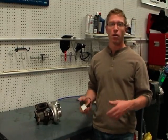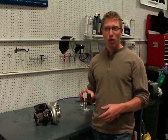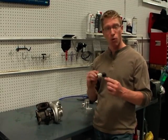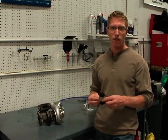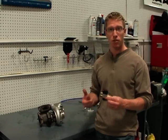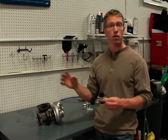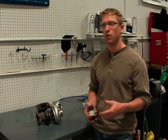You should be advised that if you're having boost troubles, earlier Motronic 4.3 and 4.4 cars — around 94 to about 98 — utilize a different way to sense boost. The computer extrapolates boost based on the mass airflow rate, the RPM, and the throttle opening, then controls the TCV to hit that target. Later model P2 cars running ME7, from as early as 99 up through about 2008, actually have a boost pressure sensor that directly senses boost pressure. That's located either in the intercooler outlet on later cars or in the tubing between the intercooler and throttle body on slightly earlier models up to 2002. Those sensors do have a high failure rate and are commonly a source of incorrect boost, so that's one thing to look at.